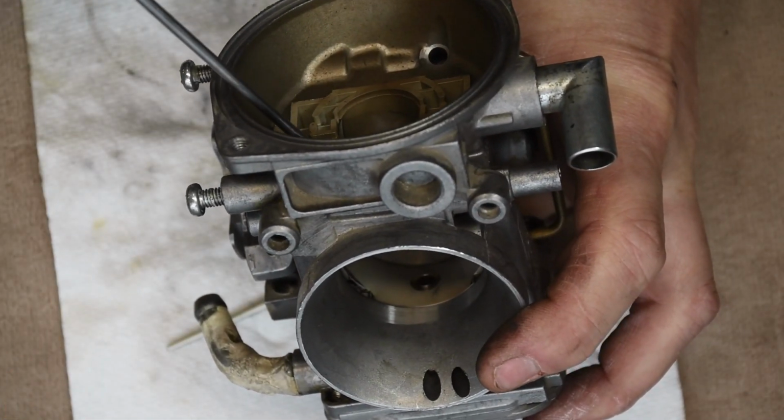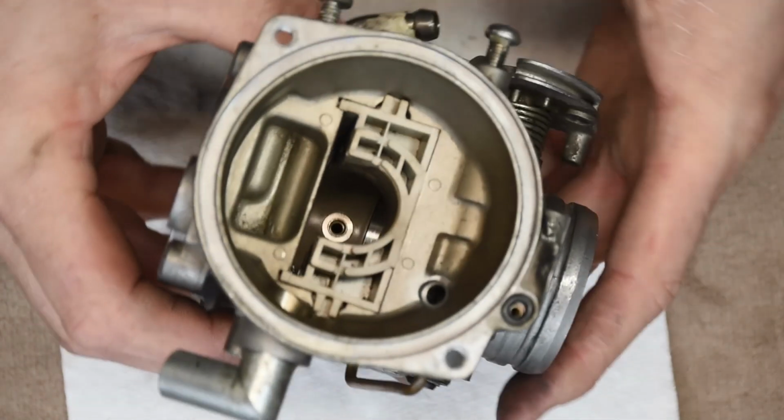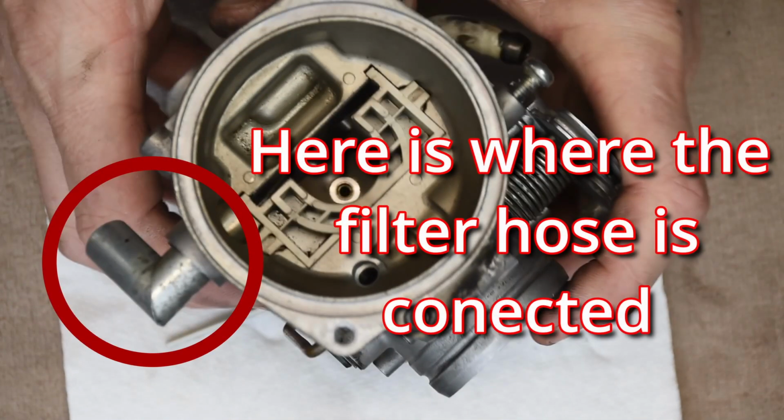Well, over and above the obvious damage to the carburetor if it gets so dirty that it starts sucking particulates in, probably what most DR owners are going to notice is that the carburetor is going to become less responsive. And this comes right back to the BST-40's constant velocity architecture. In order for those bellows, that diaphragm, to actually be pulled up with vacuum, atmospheric pressure has to freely flow below it into the void chamber that's built into the carburetor body itself. This allows those bellows to freely move up and down as air is exchanged across this filter.